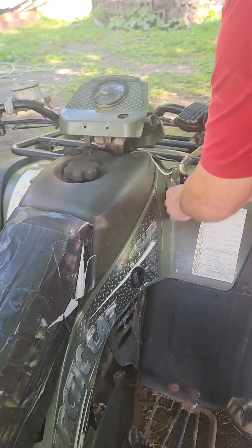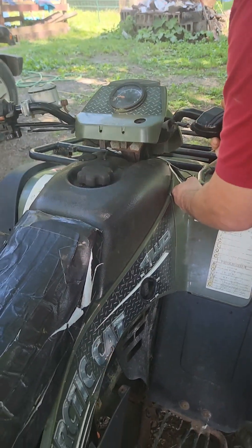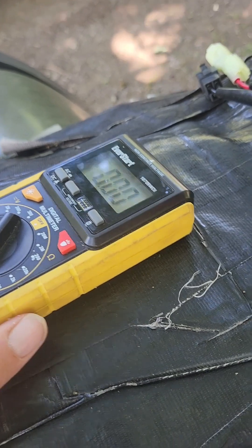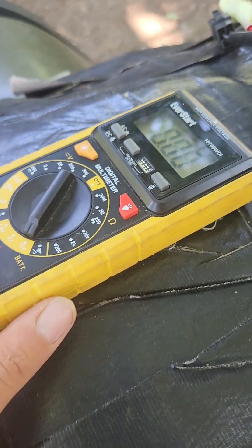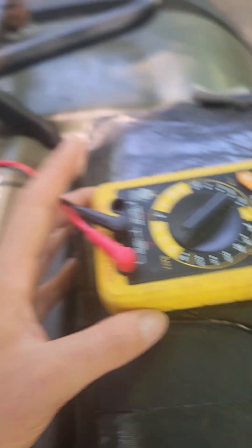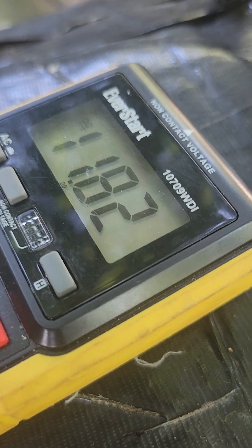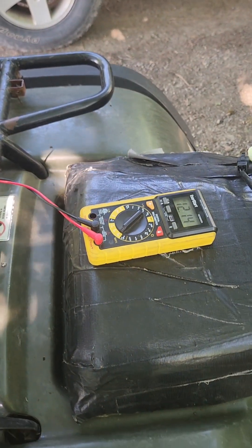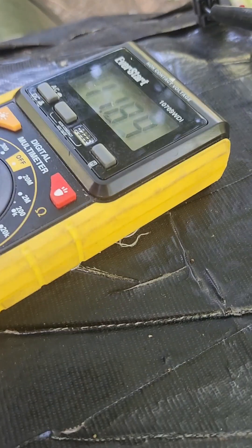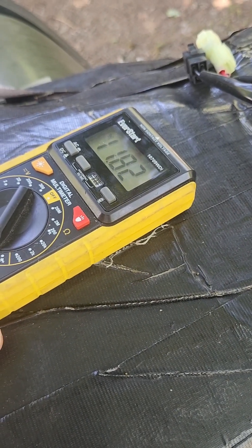I also started it up — I have it a little hot-wired. Now watch the voltage regulator. I've got to touch it to the battery terminals. So now that it's running, I'll touch the battery terminals again and the voltage goes down to 11.82. That's how I figured it out. Even if you rev it up a little, it goes right back down. It's kind of all over the place. So we're going to change the voltage regulator and see what happens.